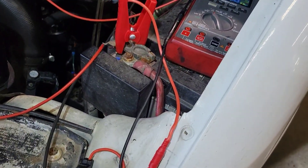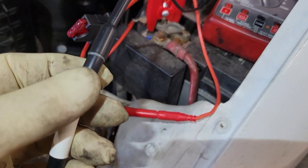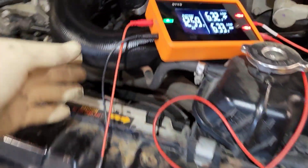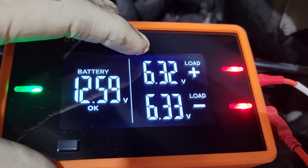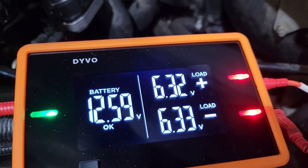The leads for the Devo meter work like this: you have a fused 22-foot cable that hooks to the battery, comes over here and hooks to the Devo meter, and it shows you what battery voltage is. Then you hook up your other leads to the different circuits and that shows you the voltage that's available.